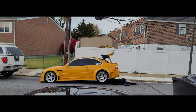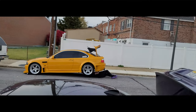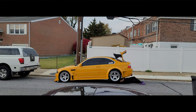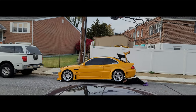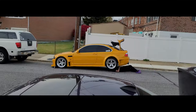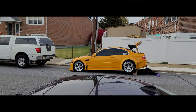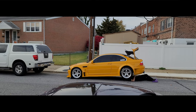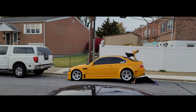It's just not enjoyable right now — I need a better gear ratio. Vlad's going to remove the welded diff and put on my stock open diff so I can actually enjoy the car and corner hard, because cornering with this diff and these tires is sketchy as hell. Then I'm going to look for a better diff to weld — probably a 3.64 ratio or a little higher — and put it back on for more slides.